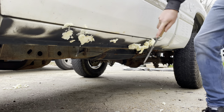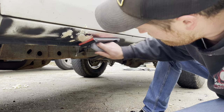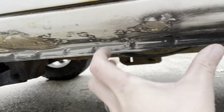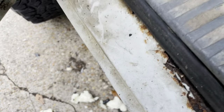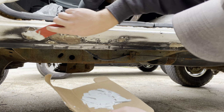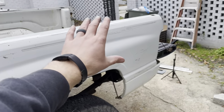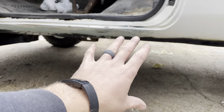It's the next morning. This stuff is all hardened up - time to cut it and sand it. We're all sanded down and ready for bondo. The reason we use this spray foam is that this rocker is rock solid now. It expands to fill the whole thing - even inside this rocker panel, which was kind of a mess, it's expanded and the whole rocker is solid as can be. Now bondo - this stuff smells like my childhood, I'll tell you. Our bondo is hardened - gonna take some 80 grit and sand it down. I gave the truck a nice wipe-down wash while I was waiting, so our surface is nice and clean.